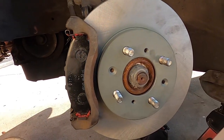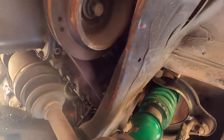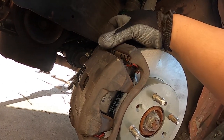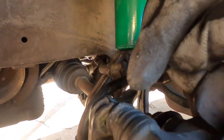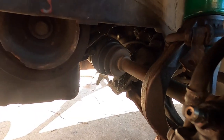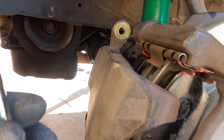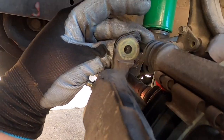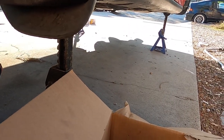Put that back in and install your caliper back onto the bracket. The back piston goes on the back of the brake pad. The caliper goes through these slots on it. Once you put the brake caliper in, there's a nut or boot that goes in here — take it off and lubricate it first. These have slots with a flat side, and the flat side will go where it mounts up to the caliper — make sure you put it in that way.